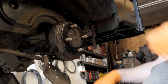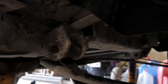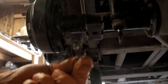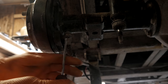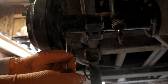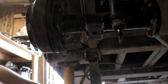Don't be afraid to cut the bolts if you need to — sometimes you just got to cut the bolts. I have to cut it on this side of the hanger, so I have to get the brake cable out of the way. Bend it down, move it out of the way, and then this pin here should just pop up. Okay, so now your brake is released — that's all there is to it.